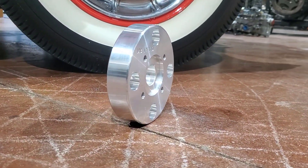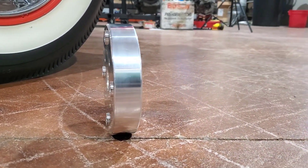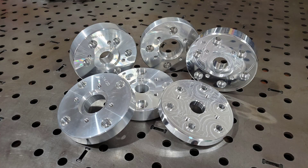Men's Force is here to make your life a lot easier when having to deal with adapting a drive shaft in your build project. All of our adapters mate to a Spicer flange, allowing for the use of a common U-joint style drive shaft. To gauge the size you need, simply measure the center of the yoke to the center of one of the bolt holes and multiply by two.